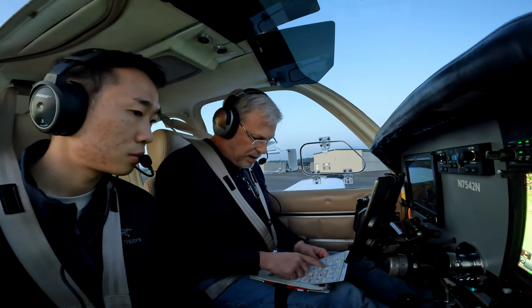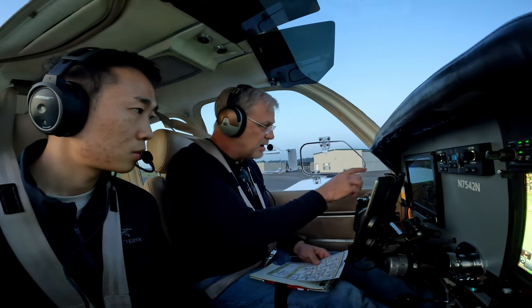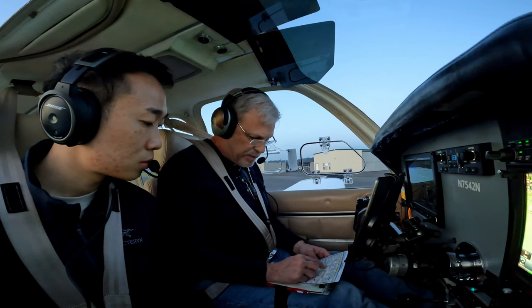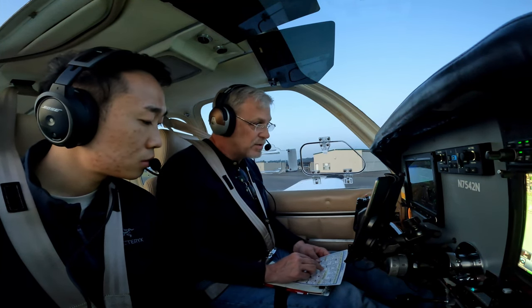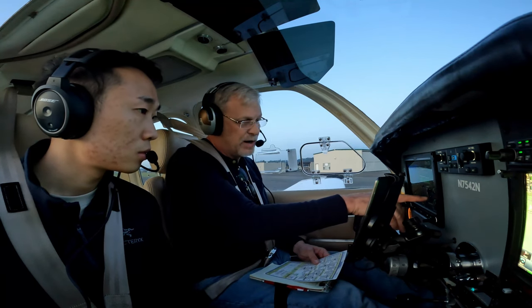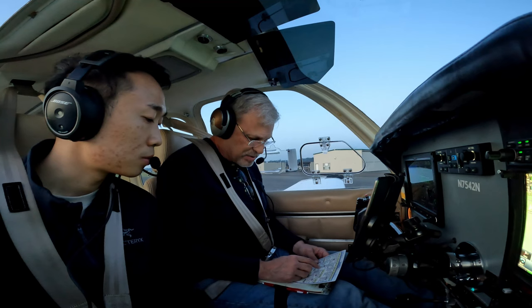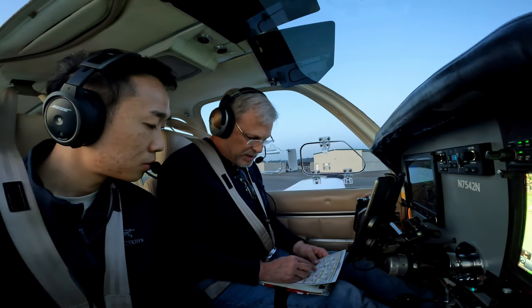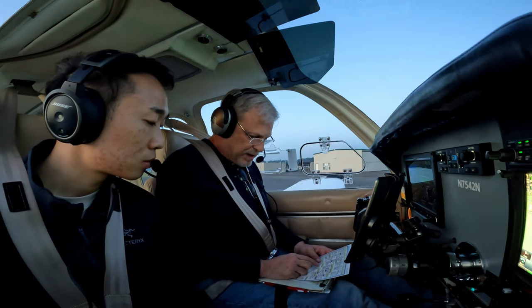Alrighty, so flight controls I already did, instruments are good, we've got the altimeter set correctly at this point, we did the best power, and we did 1700, we did the mag check, did prop cycle, the amps and volts are still good, and we never get above one on this plane. You have to lose your alternator for that. Fuel flow is good. Oil pressure's good, oil temperature's good. We did an idle check, and we did friction lock, just so we're ready for takeoff.